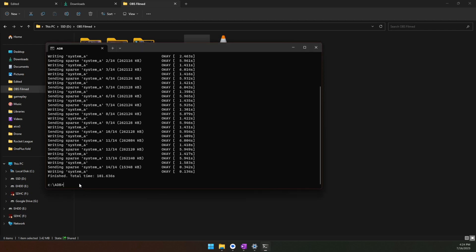At this point, what you can do is Fastboot Reboot. Now on the initial installation it was Reboot minus W, but we don't need to do the minus W now — just Fastboot Reboot. And this thing should very shortly be booting up. As you can see here, we should be in our operating system very soon. Let's switch to an overhead camera and we'll see what is different on this new build.